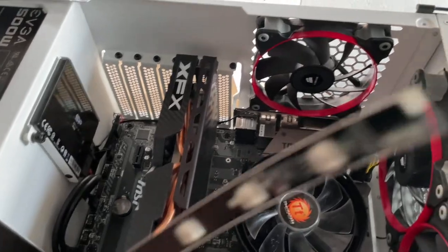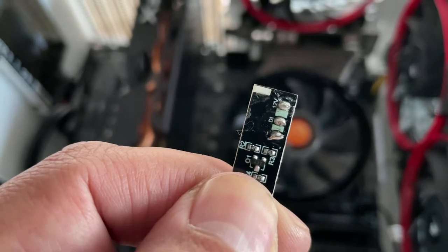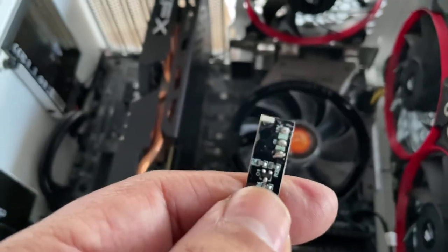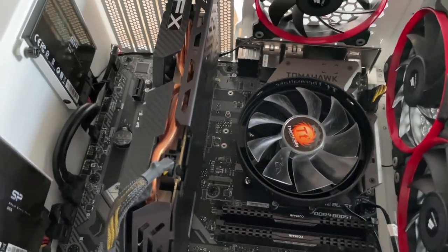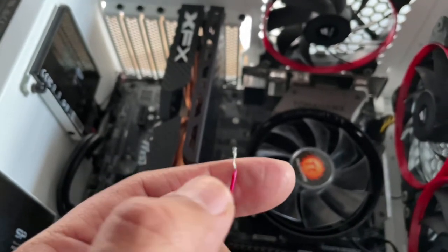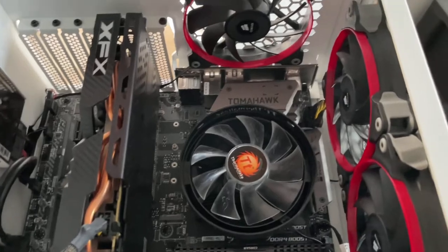This right here, I looked at the soldering connections on it, and they really weren't the greatest. As you can see, there's your 12 volts, your D, and your negative. Negative is near my thumb, then the D, and then the 12 volt. The soldering connections weren't that great, and I think somehow these two cables touched because they didn't solder them at the point. They had some length to it, and I think they got touched somehow during packaging or whatever. But anyway, I'm just glad it didn't screw up my system board. All that seems to be good and dandy.